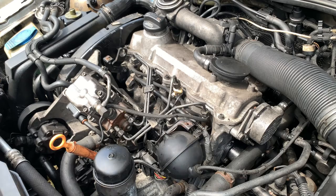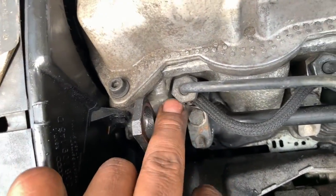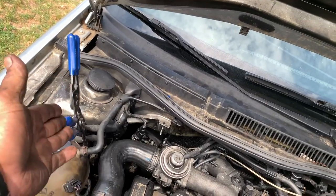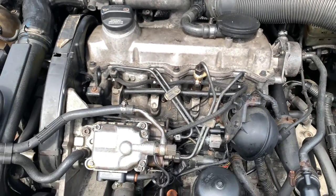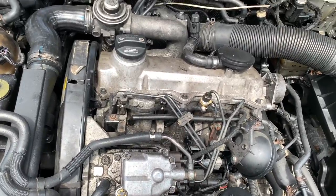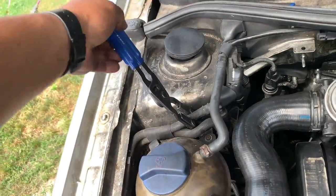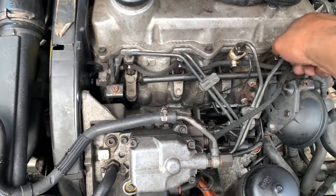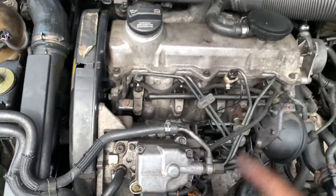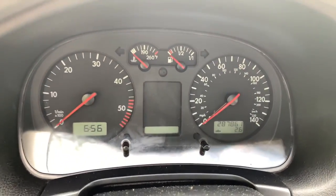So after that, the only thing we got left to do is plug the last injector, plug it up, undo the clamps, the pliers, and crank a little bit so the air comes out right here. And that's it. Hold on. Let me go get the plug. It's done. I just put the plug. And what we're going to have to do is undo the pliers and crank the engine. And we're going to let it build pressure right here, so it drains all the air out. And then we're going to come back and tighten it down. It might act a little bit weird, because we need to adjust the injection quantity.